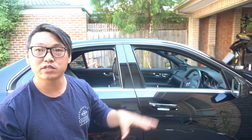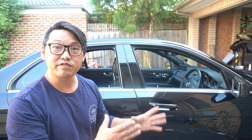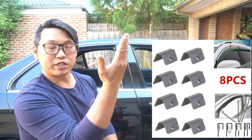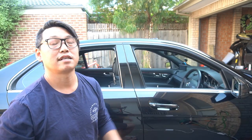In this case, we don't need that because the style of wind deflectors that I'm installing today don't even need adhesive strips. There is a little bit of adhesive at the top of my wind deflectors, but my specific type are fitted into the gaps of your windows. You use these tabs which you shove in between the wind deflector and your window, and that pretty much keeps it in place.